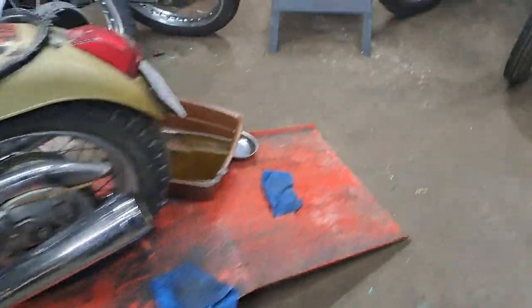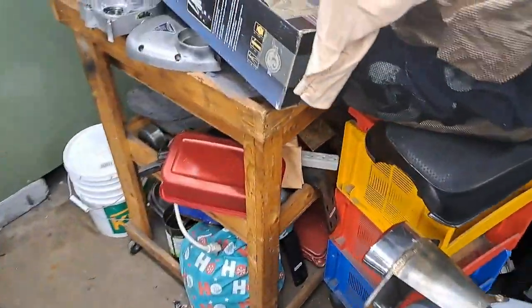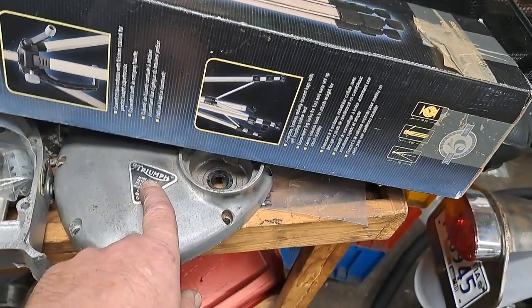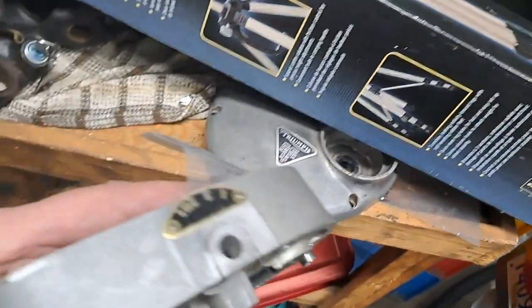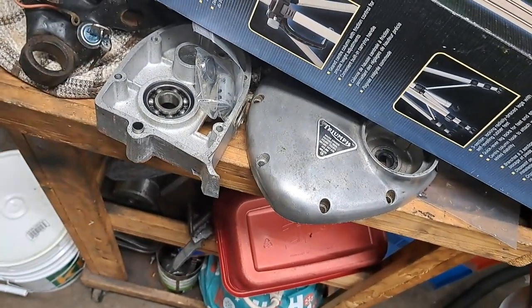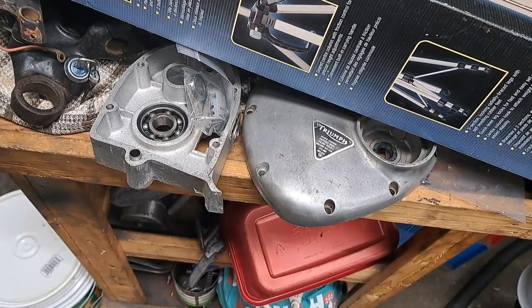Oh, what was the other little project he had for me? Well, first I'll show you some of the other little stuff I do now and then. Like a fella from up in the valley, he's a guy in the local vintage club. He came up and he wanted me to put a new seal and a new patent plate in that timing cover from a 500 Triumph, and that new little indicator plate for the shifter, and a new steering lock in it. I did the bottom end for this engine for him last winter, I think.